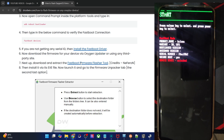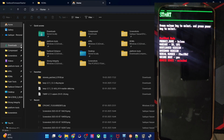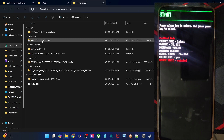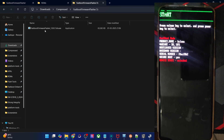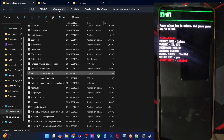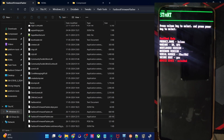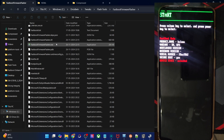You will now have to get hold of the Fastboot Flash Firmware tool. Download and extract it onto your PC — upon extraction you will get a few files. Install it to any location; in my case, I've done so in the C drive. Once installed, launch the tool via the Fastboot Firmware Flasher exe file and the tool will take you to the homepage.